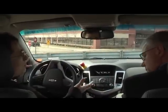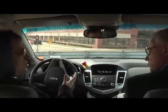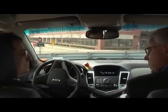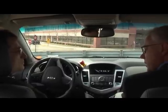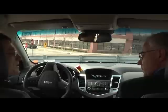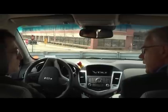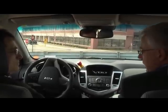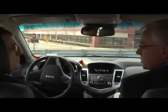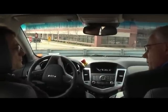If you wanted to run air conditioning at a modest rate on a warm day and keep yourself comfortable, would that eat into the 40-mile range? Everything you do takes energy from the battery, so it depends on how much air conditioning or heat you're using. Very mild use won't have a significant impact. The heat is electric as well, so one thing we're planning to do is make heated seats standard, because it's very efficient to heat the person directly — that provides comfort without putting as much energy into heating the whole cabin.